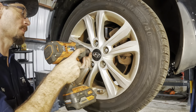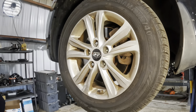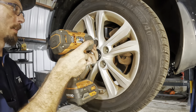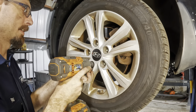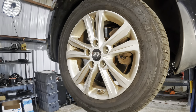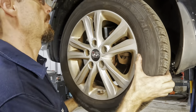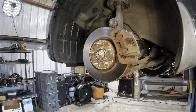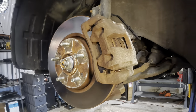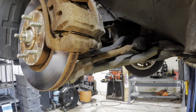I've already located and found the steering shaft - that thing is on order, I won't get it today. But we can still proceed with the overall diagnosis. Here's how we need to check for this binding condition: we're going to pull the wheels off and then disconnect the tie rod ends from the left side and from the right side. At that point we can maneuver the suspension system left and right, and if we feel either side binding, that will help us isolate the component causing it.